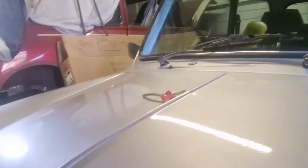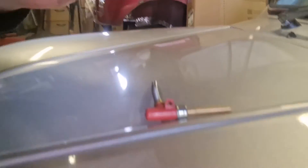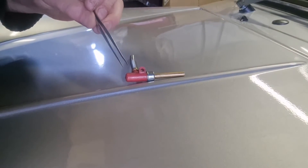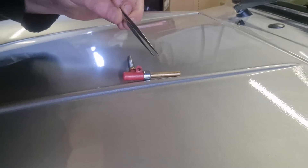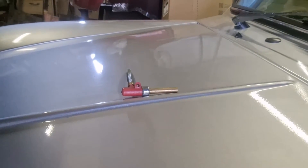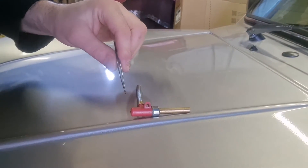What you would normally do is a fixed jet conversion, but because I want to keep this car looking sort of original, I'm not going to do that. Here is a fixed jet — you can see the base of it is just a solid pipe, and then the jet goes into the carburetor. The wax stat has a large section which we'll show in a minute.